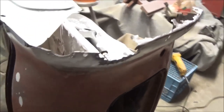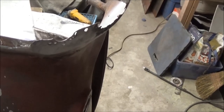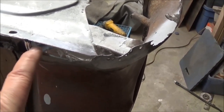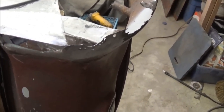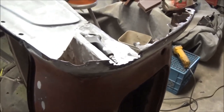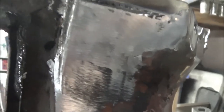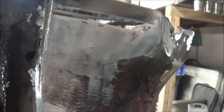This tail light area has a little wrap-around piece, and it looks like I have some lead to contend with. I was trying to weld in this area before and I thought I had some brazing, but based on this cutout it looks like there's lead in there as well. We'll get the torch out, melt the lead out, and then make the repair panel. There's a lot of lead along that seam back there, so we're going to have to check trunk fitment later — there's likely going to be a big trunk gap that we'll need to rectify.